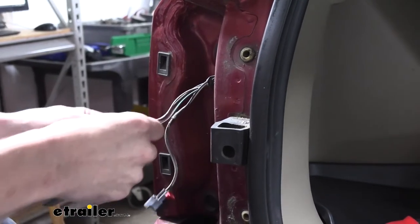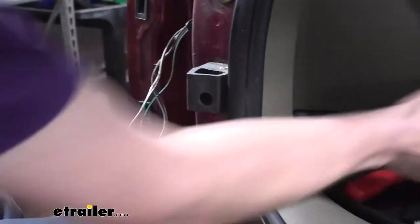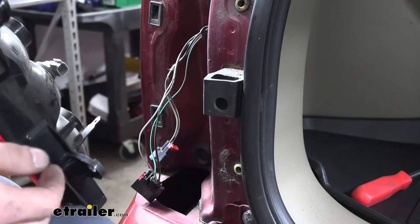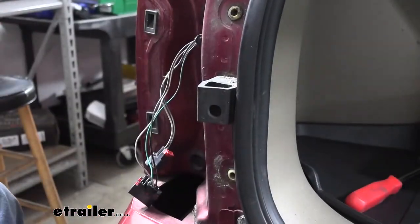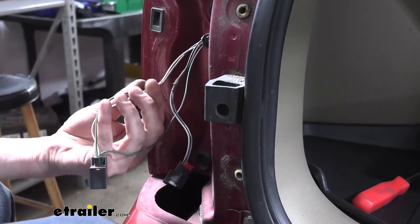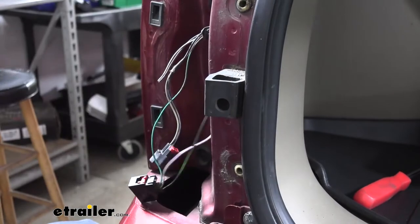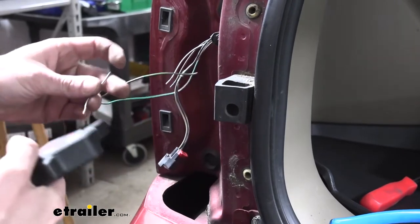Now we've got better access. Because we are going to have to hide the diodes behind here, and there's not a ton of room behind the assembly — you can see we've got a little bit of room off to the side where we're going to be able to still make them fit. We're going to go back to about where that tape was and that's where we're going to make our cuts. So we'll go ahead and cut both of these wires. After we cut each wire, we're going to grab our strippers and strip back each end of each of these wires.